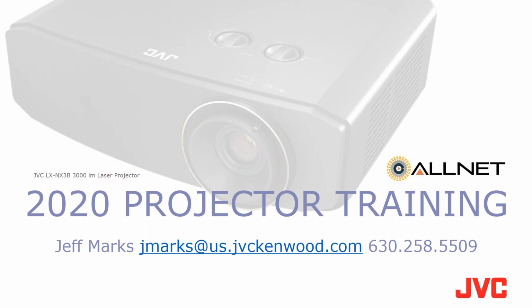JVC has a screen setting in our D-ILA projectors that will allow you to have up to almost 200 screens now. On our website, there is a list of screens with codes. As an example, if you had a Slate 1.2 gain screen from SI, you would pop in the number 114, and that would give you the amount of color offset that the screen is going to add. Every screen has a certain amount of a red, green, yellow, or blue push. We know what they are, we've measured them, and therefore we have our projectors accommodate for that. That's on every one of our D-ILA projectors.